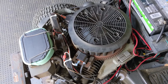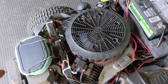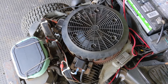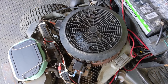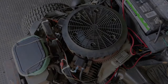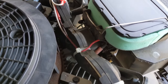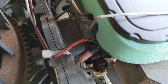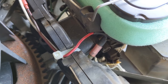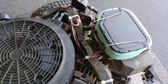Remove the spark plugs because it makes turning over the flywheel a little bit easier. Always make sure the flywheel magnet doesn't come into contact with your brand new coils — turn this over by hand, confirm there's clearance, and then we can fire this thing up. Because we used the multimeter to establish that our red wire will supply 12 volts to the fuel shutoff solenoid, when I turn the key, listen for the click. That's working properly, so we should be able to fire this engine up.